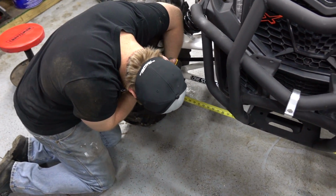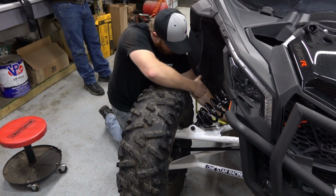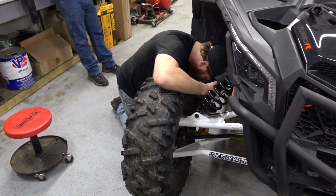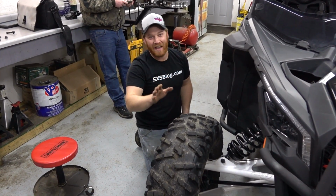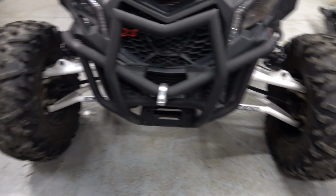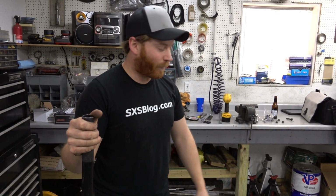We are at 51 and a half. Okay, that sounds good. I'm going to guess you're going to be at 51 and 3/4 in the back. Oh, yeah. 51 and 3/4 right on the nose. Yeah. I'm not lying either. I swear that's actually what I measured. Well, that's what the math would be. It makes sense. Your measurements will, you know, they'll change a little bit depending on where the suspension's sitting. But so, yeah, that's it. That's about 1/4 inch of toe in.